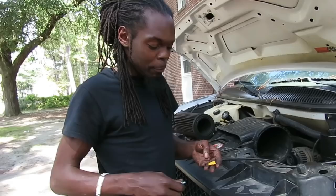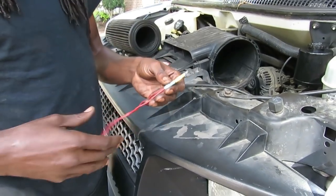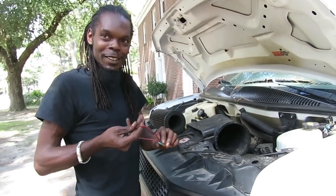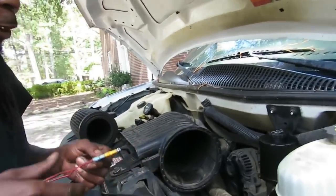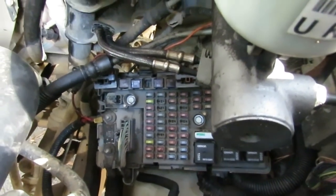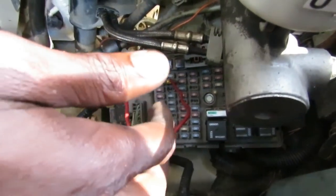What I have here is a fuse bypass. All you have to do is connect it, and this allows us to test and confirm the fuel pump — we hook up the current probe to the bypass wire. This is how you test the fuel pump with the current probe. Put it in the second slot, second row — make sure it's nice and tight and not leaning on anything else.